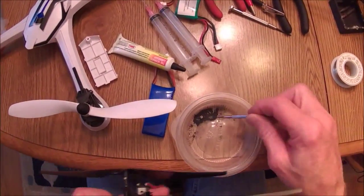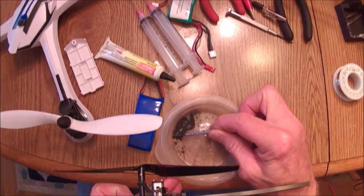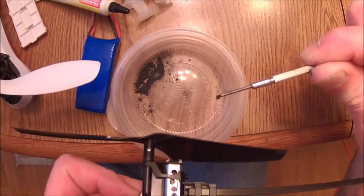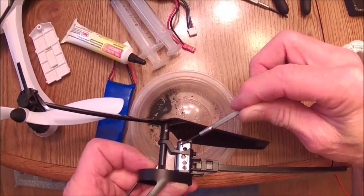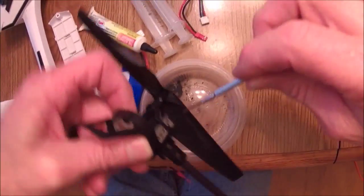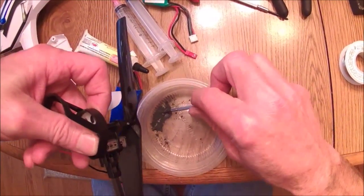All I do, I put some of the dry graphite lube in a bowl like this and just get a little bit of it on a screwdriver, just like this. You can see the hole here — the vent hole. I'll just pull that up and shove it down in there. You want to turn the motor upside down like this and just put the graphite in it like this — that's all I do.